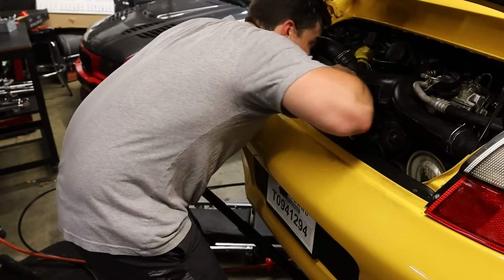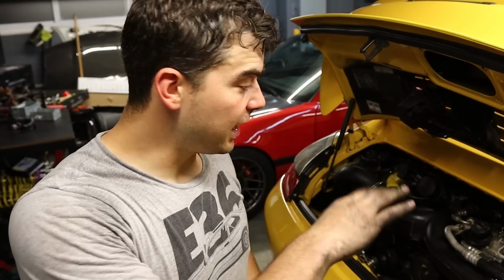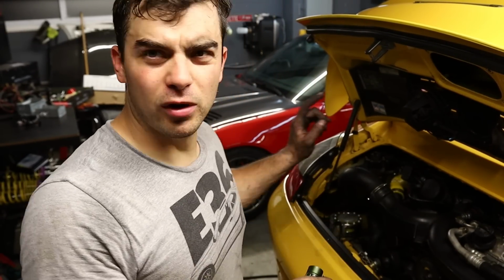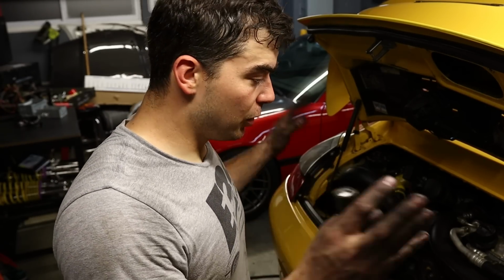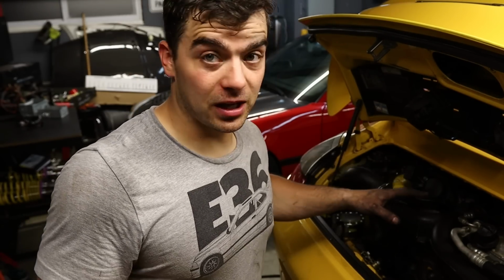Oh yeah, yes. Now my air gauge isn't holding any PSI, but you gotta think the one wastegate line is not fully seated. Back one, the turbos are completely sealed off. The intake isn't sealed off, but it's not like before, when it was a massive leak. Whatever I did, I think it's fixed.